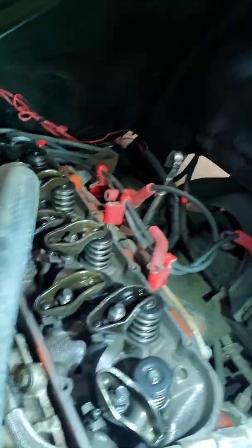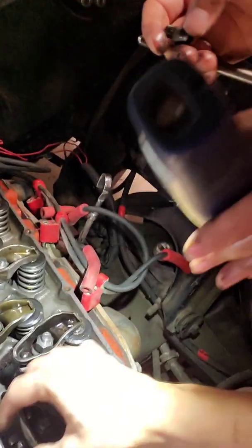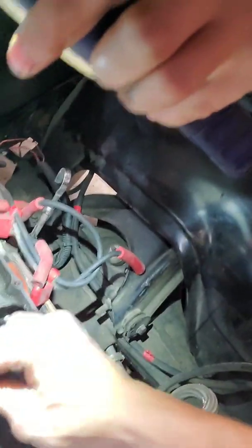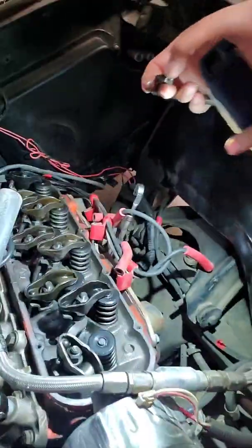And then this guy here, oh, sorry. She's bent. She's not really coming out of there. So I could force that out of there, but I'd just rather not. So looks like I'm doing a rebuild, or at least a top end on this. It didn't smoke, didn't have any negative things like that, so probably do some searching on the interwebs and try to get a better idea about what I should do as opposed to what I think I want to do. Or I just yank the whole entire engine out and just rebuild the whole dang thing.